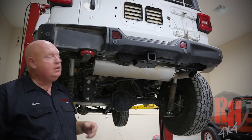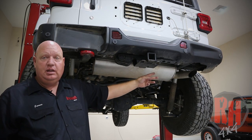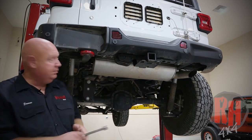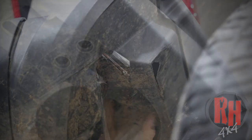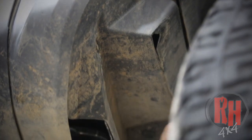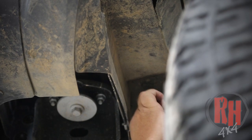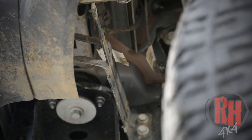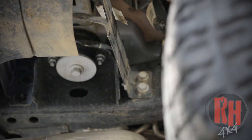Whether you're removing a stock plastic or the stock steel bumper, the idea is still the same as far as the removal. We're going to go ahead and remove the bolts along the bottom area using a 16-millimeter on this particular one. We'll use a 13-sixteenths here on the tow hook area and up along the side. Let's go ahead and remove all those bolts. Now use an eight-millimeter socket and remove the mounting screws that hold this plastic in place on both sides. Then we need to remove this bracket here at the frame using a 16-millimeter socket.